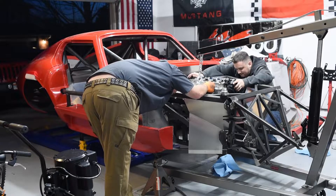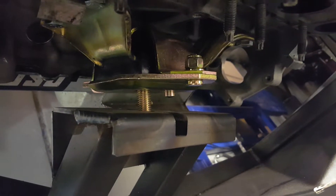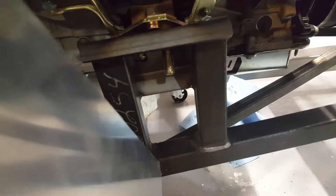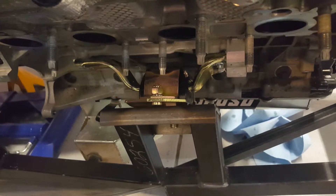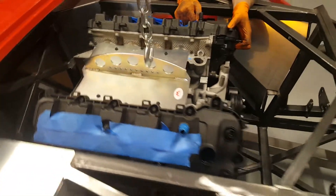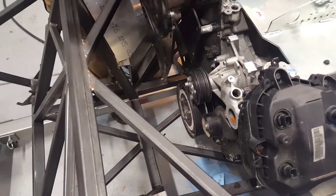It's almost like the engine bay is slightly wider. It appears that the motor is not seated on this motor mount. Is there a urethane piece they make for there, like to space it out? You probably have it in one of those boxes — we have lots of boxes. It is seated over here, meaning the width is either different or there are a couple pieces we're missing. I'm almost wondering if there's a chunk of something we're supposed to put on there — it would make most sense for the spacers to go between this mount and the block. If it fits, that's going to be amazing.